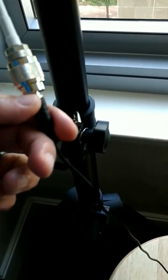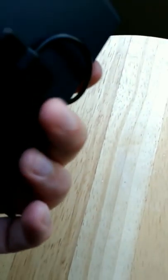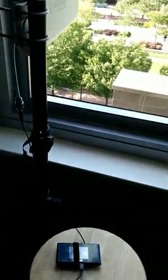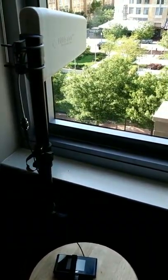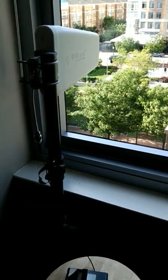This cable connects to a passive antenna adapter, which goes on the back of the device. I need this adapter because unfortunately this device doesn't have any plug-ins for antennas, as a lot of older cell phones or even some wireless hotspots still do. This passive antenna adapter fills that gap. It's not as good as being able to plug in directly — the advertised rating is only about half as good as a traditional setup. Am I seeing a huge gain in signal strength? Not really — it's pretty marginal, maybe a couple of decibels. But remember, it is a log scale, so even three decibels of gain means doubling your signal strength.